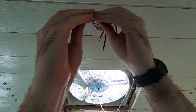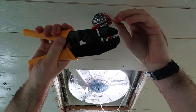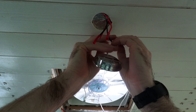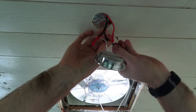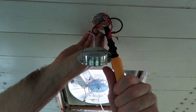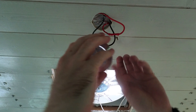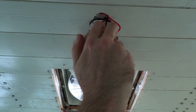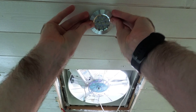Twisting the cables together and then putting the butt connectors on the end of the black and the red to start with. The lighting wire is actually quite thin so making sure you've got the plus and the minus the right way round, you can grab the exposed cable and twist the lighting wire round the exposed one together. This way it wasn't too thick to go into the butt connector and once it's crimped on it makes a really solid connection. So now both the red and the black wires are connected together and the plus and minus from the light are also connected to the correct colours. Now we just have to tuck the cables underneath the cladding, line up the metallic springs from the light with the grooves cut in the hole, then just push it in.